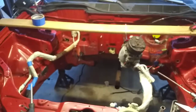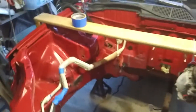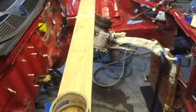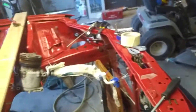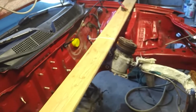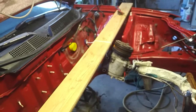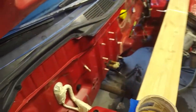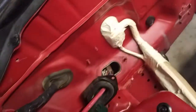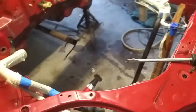A little status update on the Civic. I've got the engine bay basically completely stripped except for the wiring harness and the AC system, because I didn't want to have to discharge it. I can reuse the D-series compressor on the B-series motor using a bracket out of a CR-V, which is kind of cool. Got everything pulled away, starting to mask stuff off, making pretty good progress.